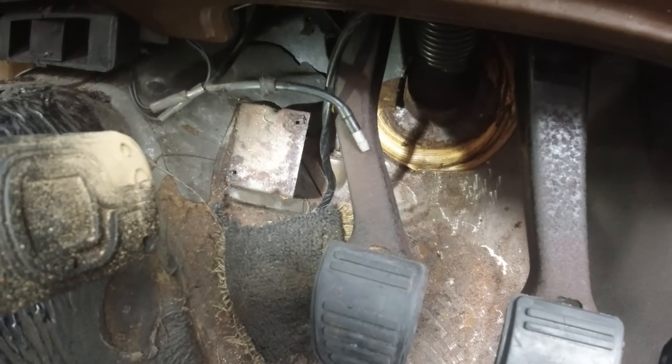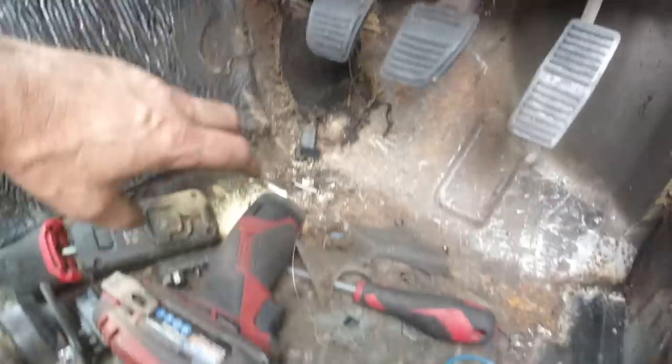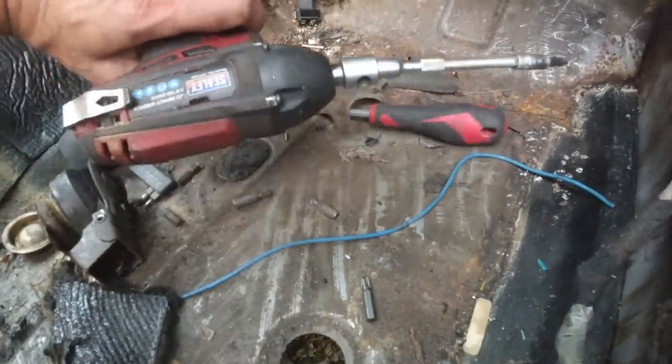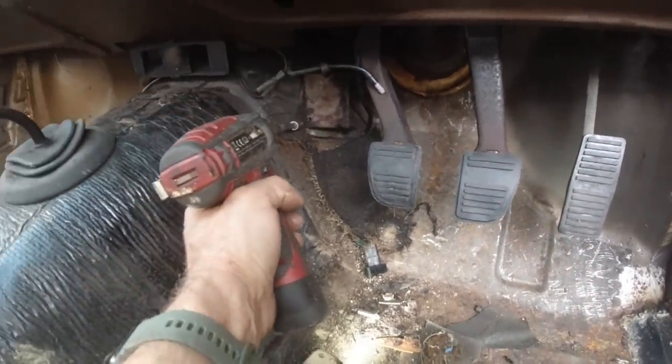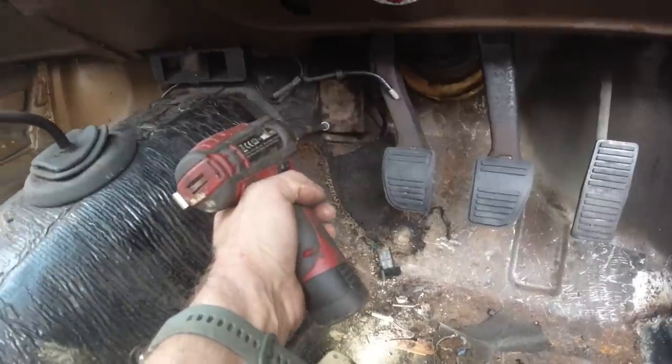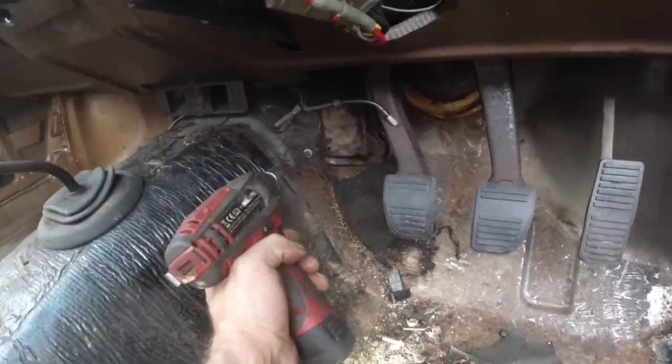You're into drilling and retapping with larger screws. That's the only option, I would say, after that. You'd probably have to file the heads off the screws and then drill through. But by using this and some penetrating spray, I'd probably use something like Fertan or plus gas, which is pretty good as well.